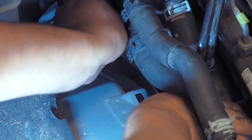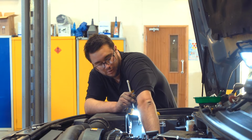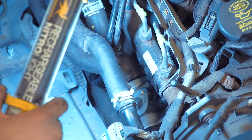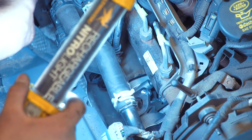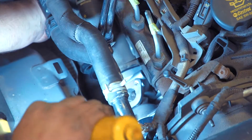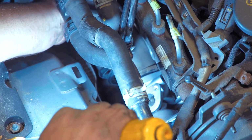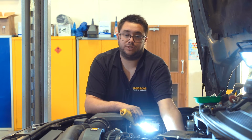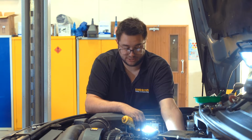Again, just reach underneath, make sure the gasket is aligned properly before you try and fit the second screw. Get it started in the hole, and then take the extension with the socket on again from behind. And then start it in the valve, making sure the gasket hasn't slipped down, because if you miss the gasket and tighten everything up, it'll make a really annoying whistling sound.